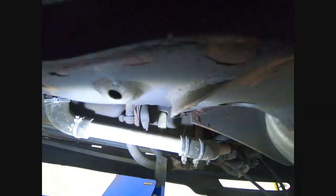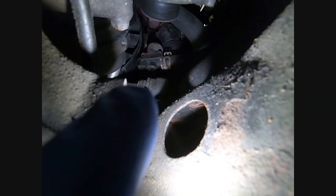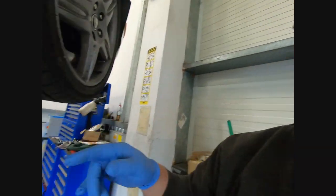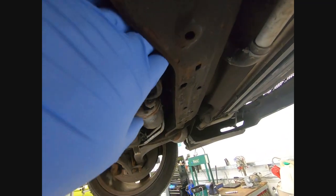Up here, you can see that is where the valve is. You can see it is pink on the outside - that is where it's leaking. There's not any residue down here, but that's where it's leaking from. It's a bit of a pick to get to. On the S-Type R with all the V8 engine, you've got no space - I can barely fit my hand up in there.